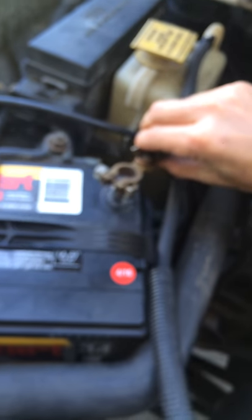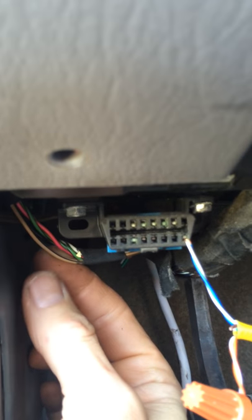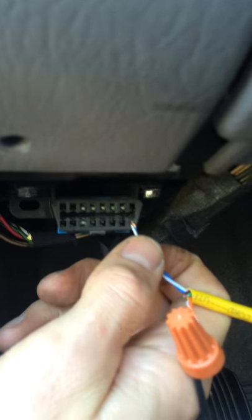Let's just demonstrate real quick. I have this here — it's just jerry-rigged up. That's my power, battery's in. Just for fun — remember, always make sure your car is in neutral. Car's trying to start, all I gotta do is push this button. And that's how you bypass it. I'm just gonna wire-tie some stuff off and clean it up. I'm probably just going to poach the power straight from here and tie it into this. That's where my 12-volt positive is.